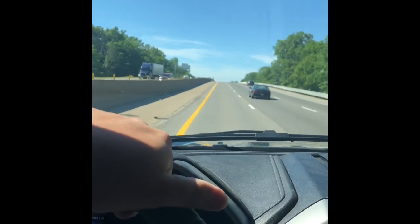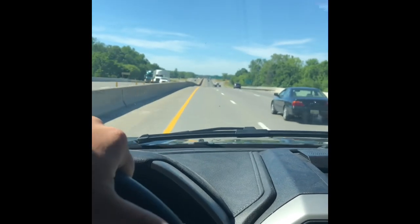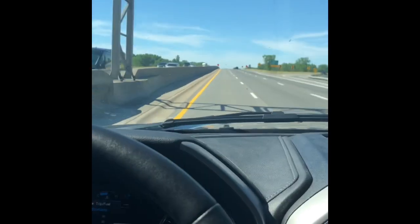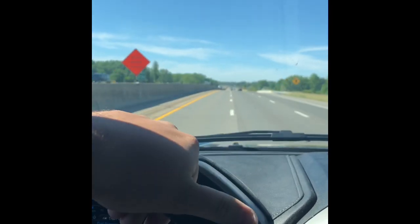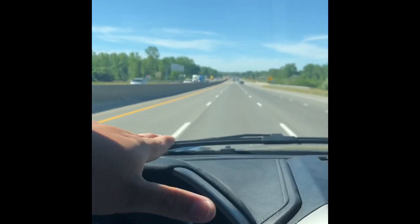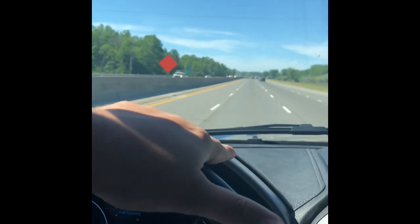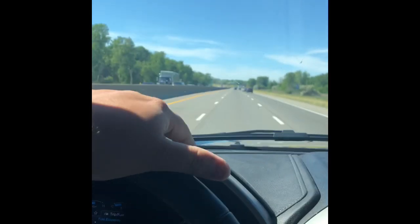On that note, earlier in the video, when I was first learning how to use the Derringer, I was trying to get a Bank 1, Bank 2 upstream EGT. Now in this truck, the only available things are 4 total, all Bank 1. I'm assuming that's just how they labeled it, because there's a single pipe coming back from the turbo. I'm assuming they don't have EGT sensors between the turbo and the head, because this truck is set up a little differently, breathing through the valve covers, with the exhaust ports in the valley of the engine, as opposed to a Duramax or an older Powerstroke that had manifolds on the side of the motor and up pipes that went into the back of the turbocharger.